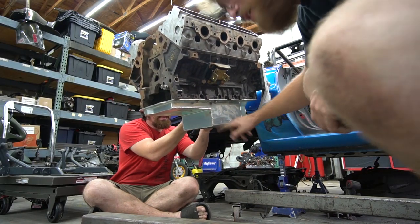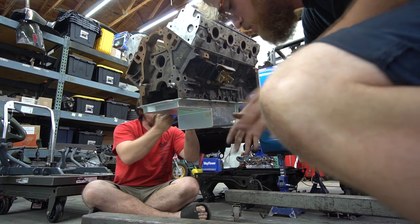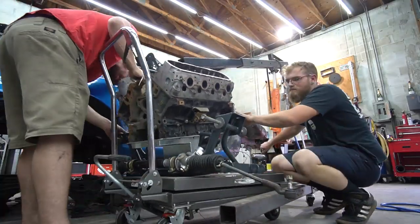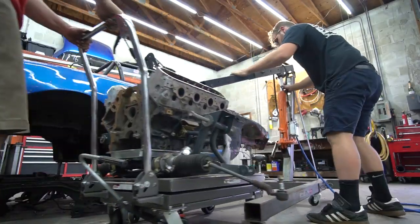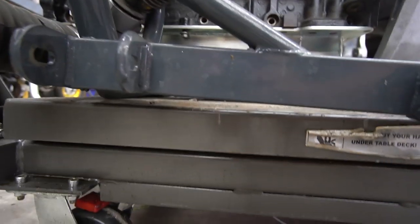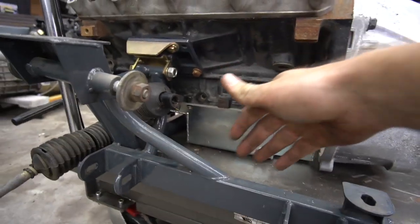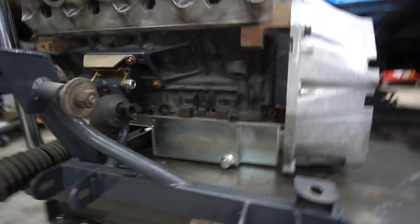I got the pan on. This is a different pan than I ran — I had a mass pan, which is a cast pan with cast-in baffling. This one actually has trap doors that open and allow oil to flow into the sump but not out, so it should be a better pan. He's going to run an accu-sump with this instead of a dry sump like I'm running. It's only about a quarter inch below the subframe — mine was probably a solid inch below, which was the main reason I switched to dry sump, because my pan was hanging so low I'd smash it over a rumble strip. This one's almost flush with the bottom, so that's pretty good.